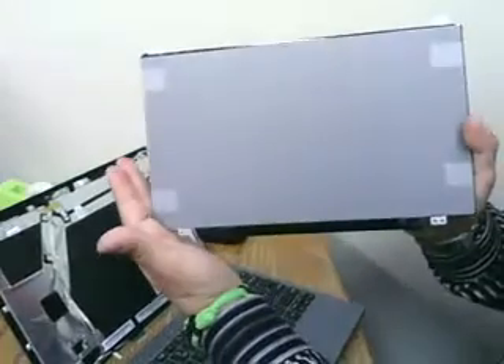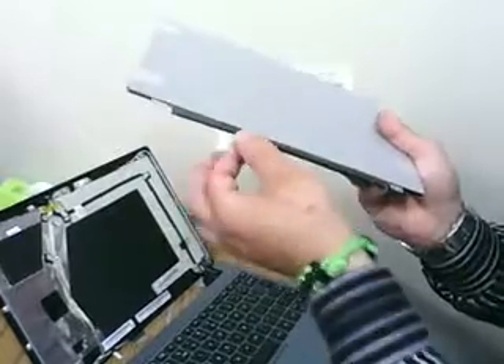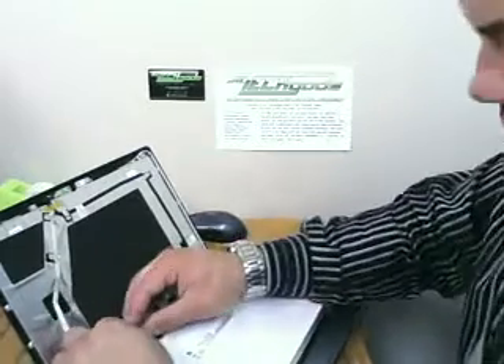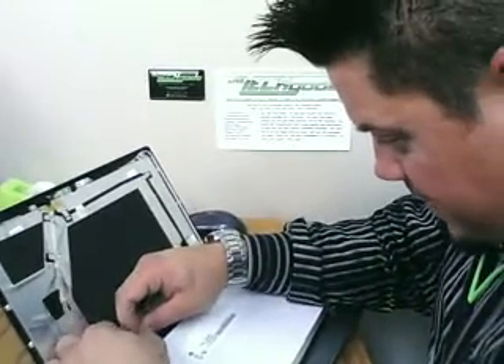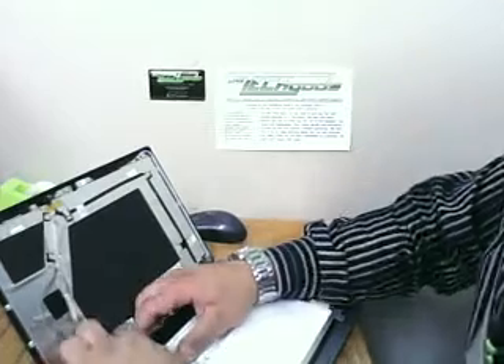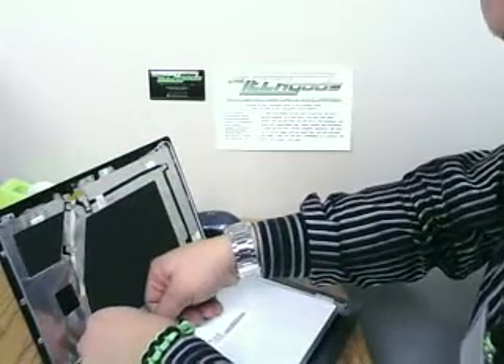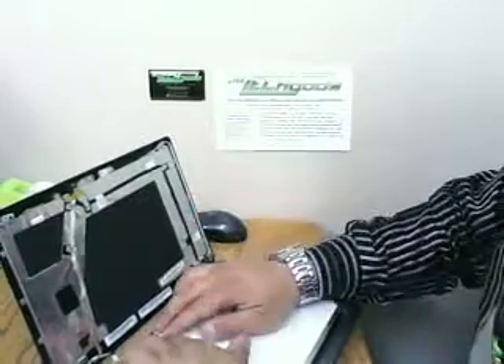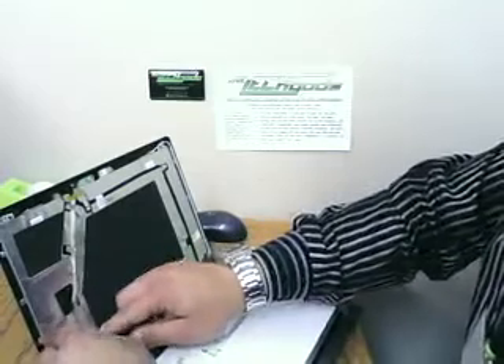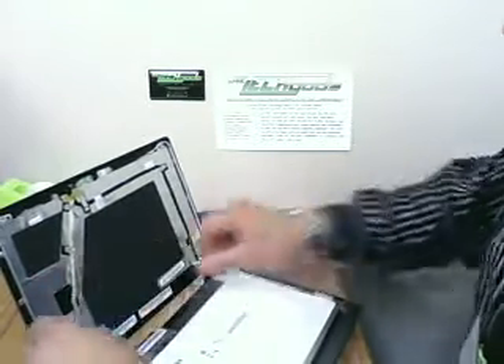And then we have our new LCD screen that needs to be put in. There's an obvious bottom and an obvious top on these — the bottom has an LCD inverter board inside it, the top is just flat across. It has a screen protector on it that'll help us get it in place without getting fingerprints all over it and without scratching it. So now we can put this cable back on — you have to be very careful to put this in straight, and you don't want to put any extra pressure on that LCD inverter board, but you do need to get it snug. Then we can put our piece of tape back on there — the tape holds it in in case the computer gets jostled around, keeping the cable from sliding out accidentally. It is a pretty snug fit, so in most cases the tape isn't required, but sometimes a hard enough hit might pull it out, so it's just a little added protection.